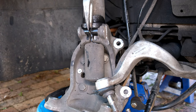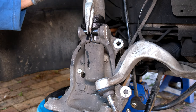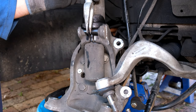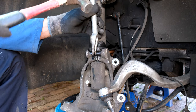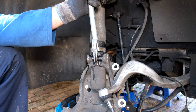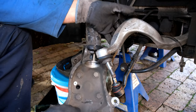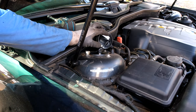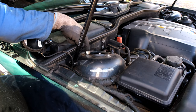I spray some oil here to help, then take my pry bar. Notice the pry bar has an increase in thickness as it goes along, so I put it in and tap it with a hammer — the part over here will come down. I have my bucket ready so it falls onto that. I just tap on my pry bar to expand the mouth a little bit and it moves really easily. Note I don't hammer on the component — I'm hammering on the pry bar. Now I want to unplug the EDC connector from the shock. If yours is a regular shock you won't have this step. I loosened nuts one, two, and three.